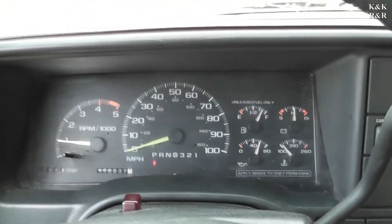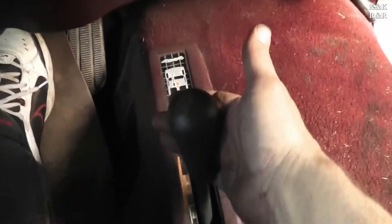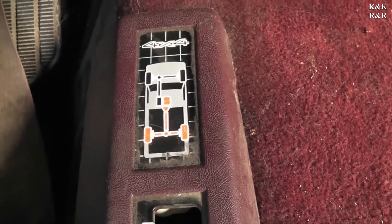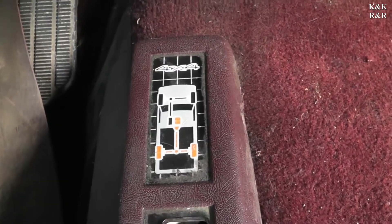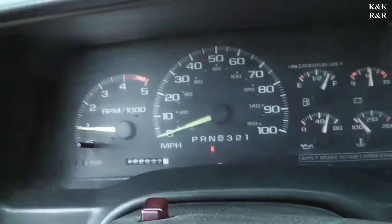The way I've always done this truck, I've always put it in neutral and then bang on the transfer case, at which point the light used to come on. Now, before you think that your light is bad — of course it could be bad — also remember that the engagement on at least the '95 happens only when you put it in drive.